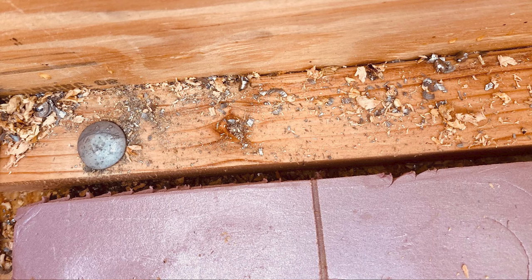In addition to that, it was important to secure the box to the actual trailer. I got some carriage bolts for that and drilled a couple of holes in the forward part of the trailer and a couple of holes in the aft part of the trailer. I inserted these carriage bolts and bolted through the bottom of the trailer to secure the box securely to the trailer itself.